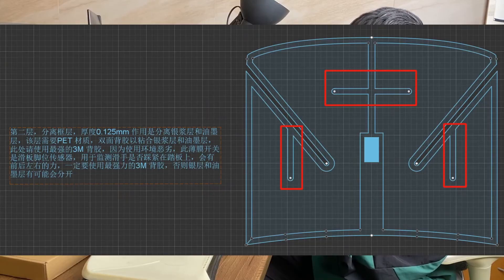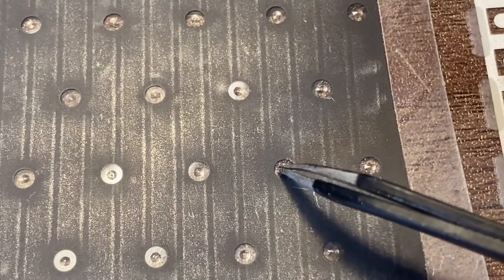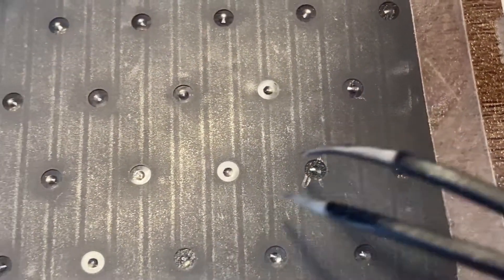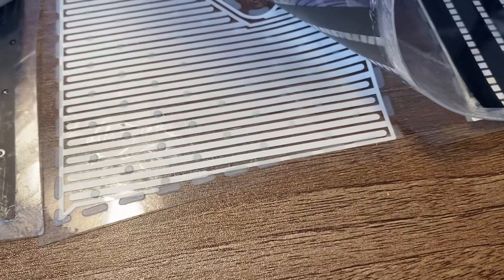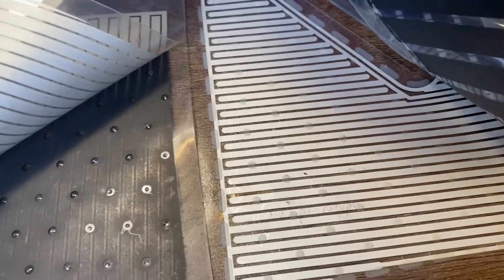Rest in peace Bumblebee. Floatwheel integrated and updated foot pads to prevent ghosting through the implementation of larger gel dots that separate the sensor layer from the contact layer on the foot pad, and through additional gel separators lined around the outside edge of the sensor pads, which the GT doesn't have.